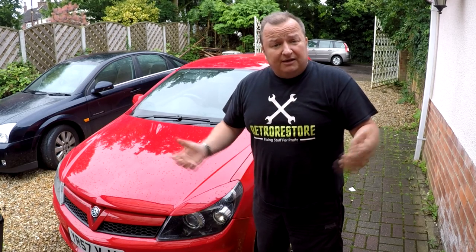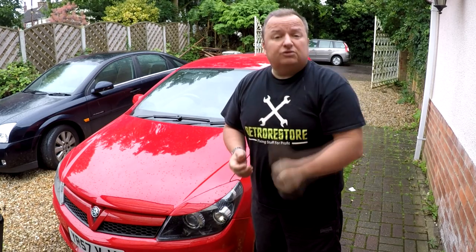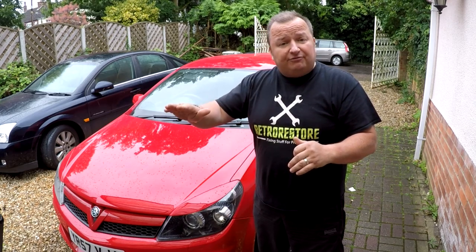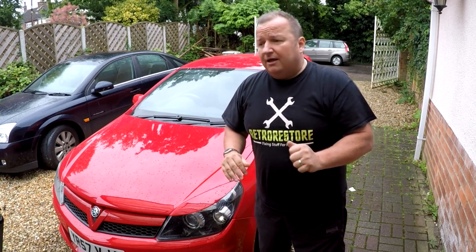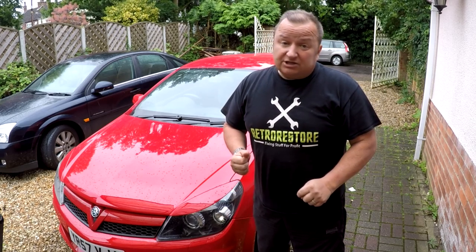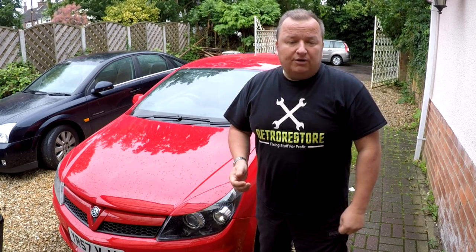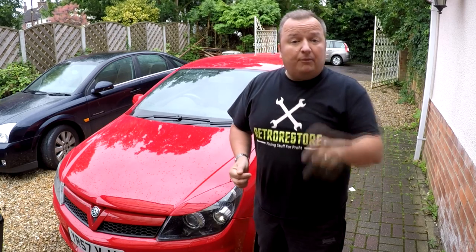That is the beauty of having the comment section — when you get proper, helpful comments. Hopefully that will benefit you. The electrical connector was called the turbo solenoid, by the way. The problem has now disappeared — Gary woke up this morning, took the car out for a drive and did more of a test drive than yesterday. He said when you're going along at speed, feathering the throttle and then giving it acceleration, that's when it was lagging — and that has now totally disappeared. The problem is cured. It just goes to show that garages don't necessarily have all the answers. Thanks very much, hope you enjoyed this video — see you in the next one. Don't forget to rate, comment and subscribe. Bye for now.